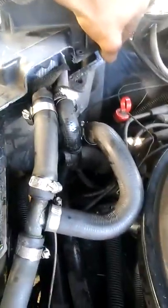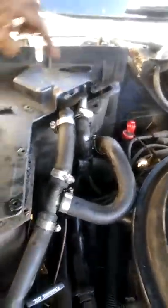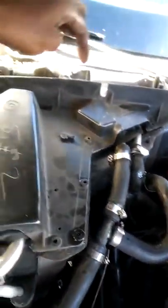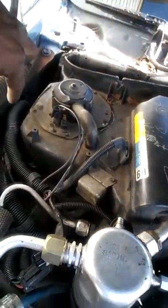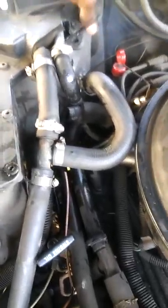When you're putting a new heater core in, you gotta take the cover off and get up all the glue from all around it — glue all the way around. You gotta get it out. I used a box knife and a flathead. Got some screws with six millimeter, six and a half millimeter, eight millimeter, and some ten millimeter.